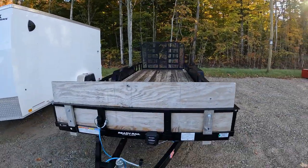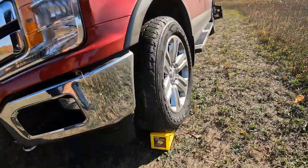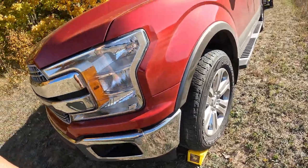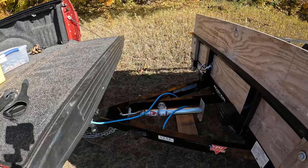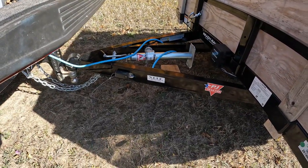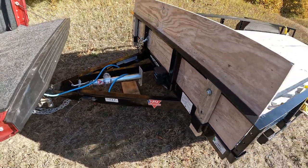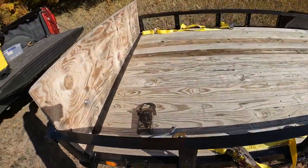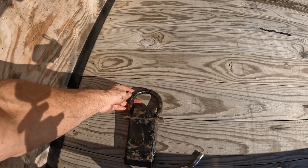It seems long or large for the 2025, but I do think this is the right setup. One thing I always do, especially if you're not on level ground: put chocks on the front wheel of your truck or tow vehicle. And it may not be obvious, but you always want to make sure the trailer is connected to your tow vehicle before you do any loading and unloading — it has to be solidly connected on the front.